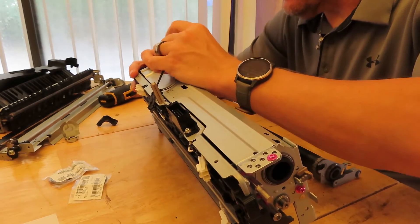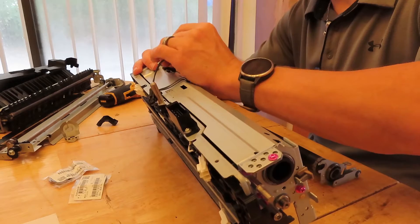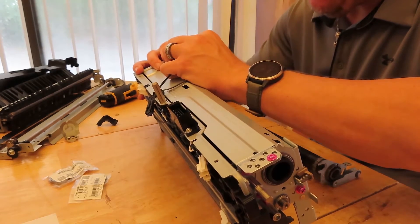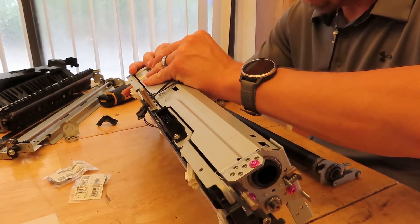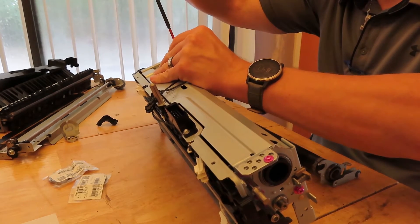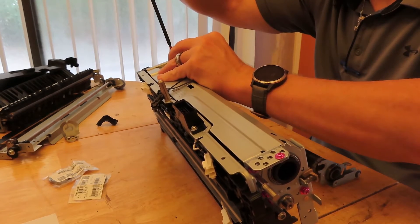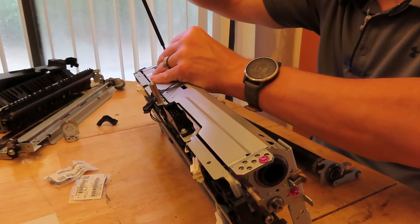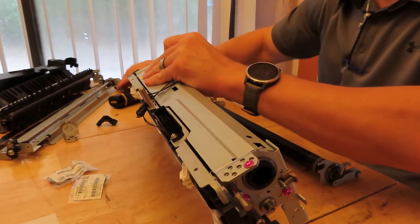Feeding the wires down through the channel — it's just one little screw. It screws in and holds it against the belt, and that basically gives the temperature reading from the halogen bulb in the belt. It prevents overheating and catching fire, and that's why when they go bad or get gunk build up on them they throw an error code — so that that does not occur.